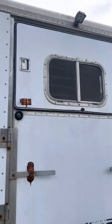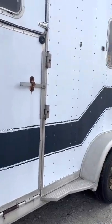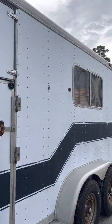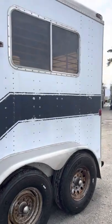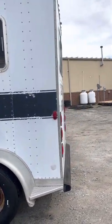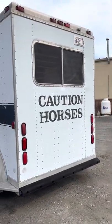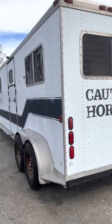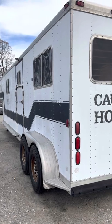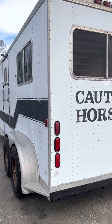It's got a side ramp on each side of the trailer. Cross members are excellent. Tires are new. The floor had some pitting and had been patched. The screws holding the patch down had rusted out, so we took those out and checked the floor. It did have some pitting — it's a 1986 model — but the patch was excellent quality material, so we cleaned under it, caulked under it, and put that patch back down with proper screws that would not rust out.